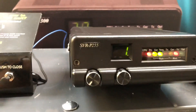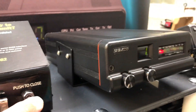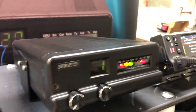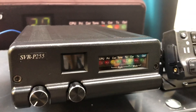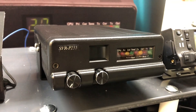Operationally, when an officer gets out of the vehicle they open the door. No matter how many times they open and close the door, the SVR stays on. When they get back into the vehicle, all they have to do is come over to the control head to the programmable key that they have set up. When they tap this, that automatically re-arms the SVR and the door switch back into a standby or disabled condition.